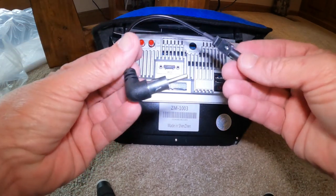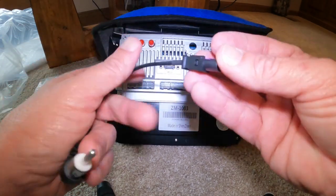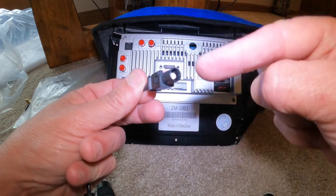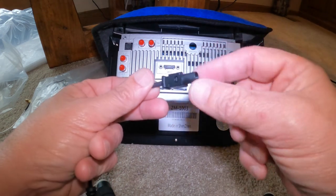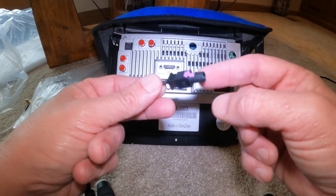The optical out is for an amp and the HDMI is obviously for other monitors. You're going to get the AM/FM adapter — you're going to see this black round connector. You're going to find the white one and plug it in there — the white one that you unplug from your factory head unit. That's the antenna.